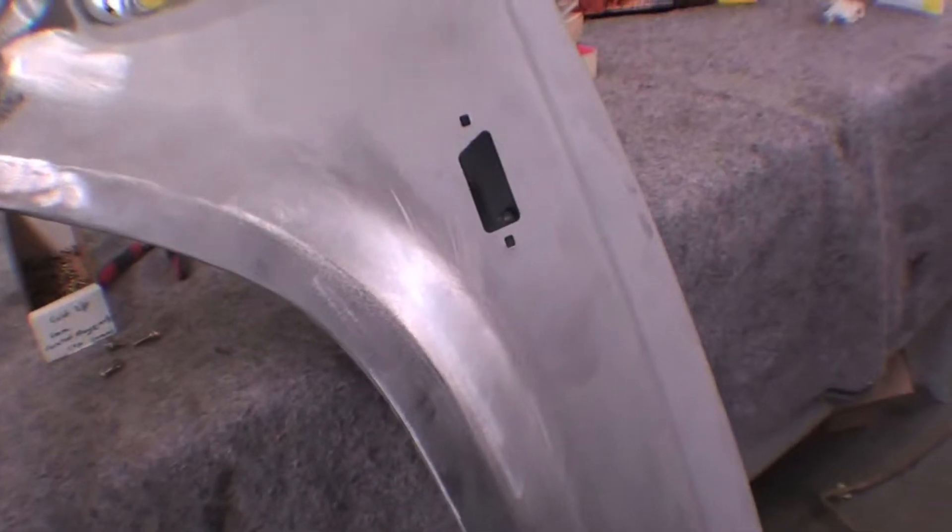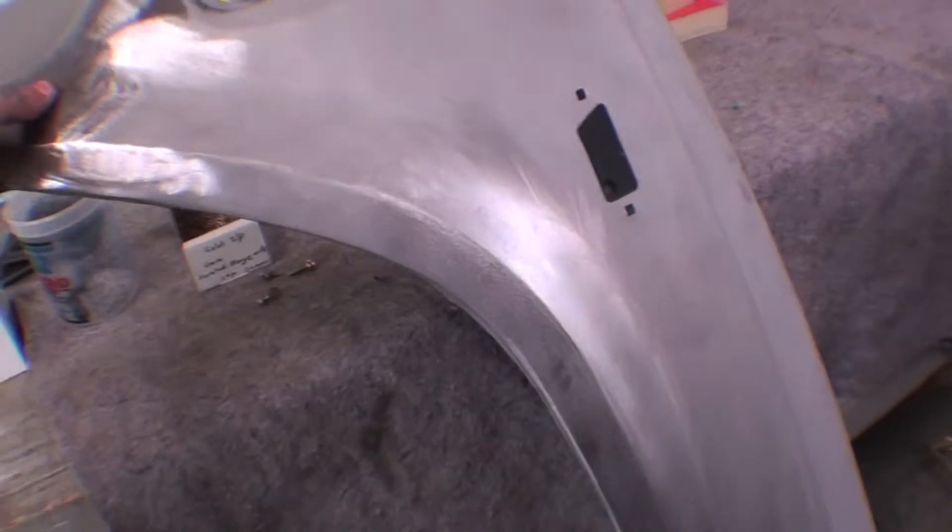Right now the fender, you can see it, when loose can move and flex quite a bit, so until it's mounted on the truck we really can't finish that off. But as you can see all the dents are worked out of it, the walnut marks, the hole's been filled. We did a lot of work in this front section where that was previously damaged quite a bit, and our corrosion's been repaired down on the bottom here. So all in all this fender's looking good, ready to be mocked up onto the truck.